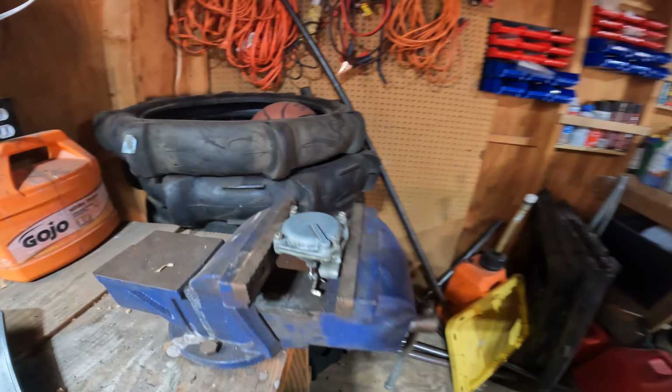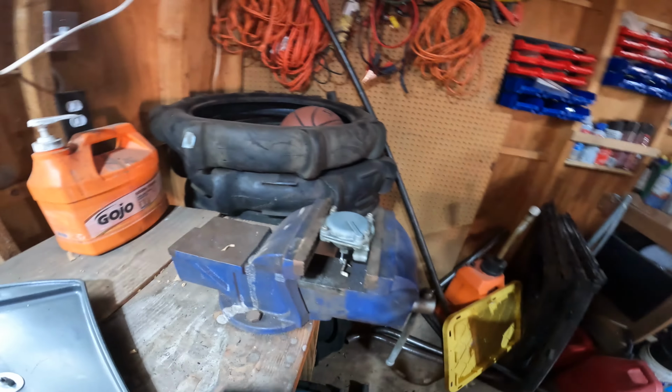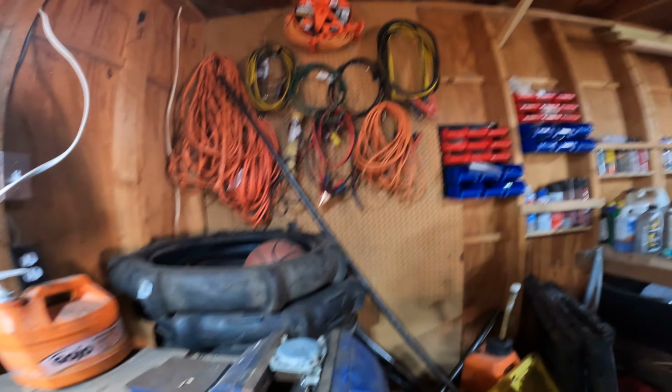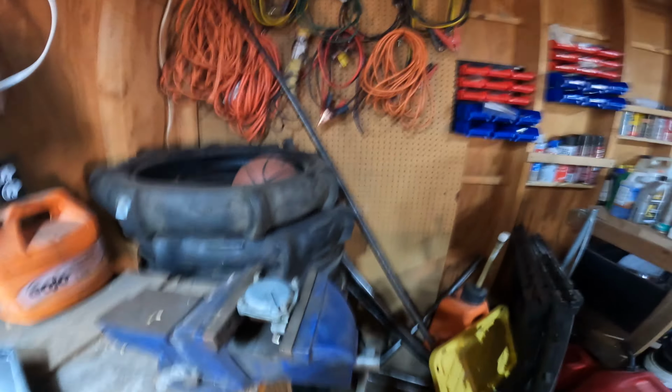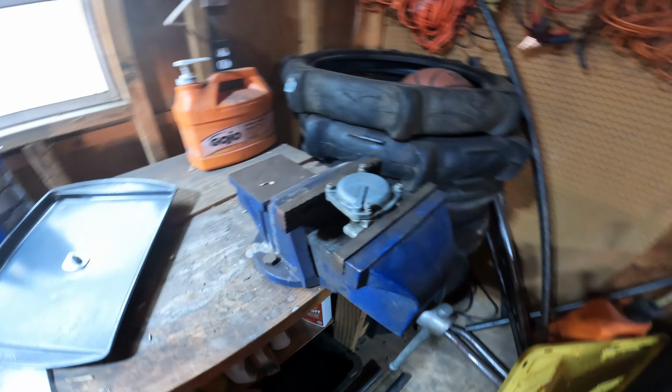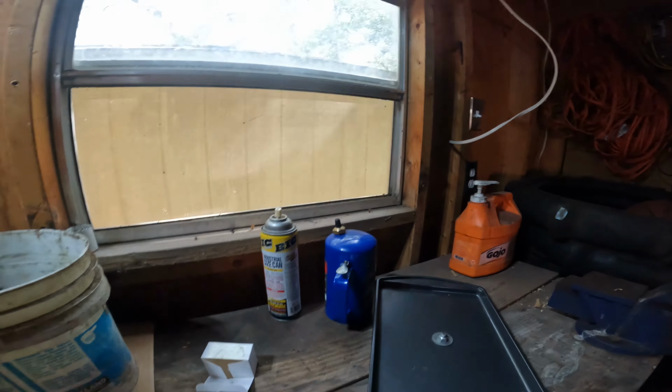Every time I tried to put that in, the spring would push this down. This is the old one. Push it down, and then these little rubber parts would go away from where I need them to go, because it would suck everything down. So how I did it is I put it in a clamp and made it so this can't move up and down, and then compressed the spring and put the top on. Therefore, the spring couldn't push this down or pull these little ear pieces out of there. So I could put the bolt in, tighten it, and get it all good.